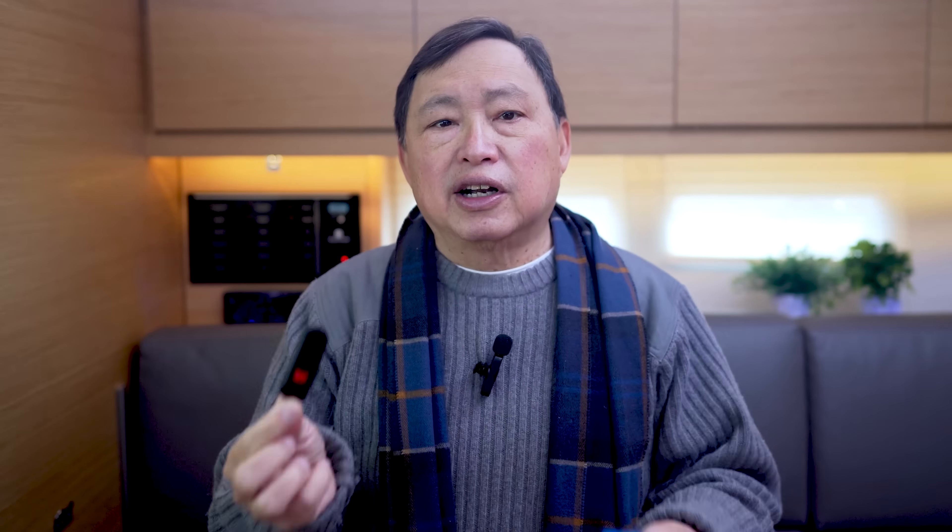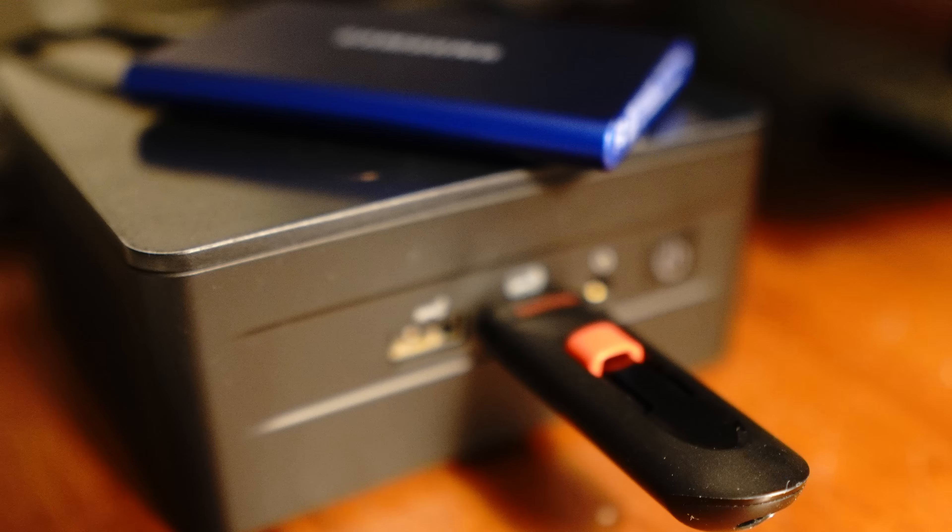Making a Clonezilla Live USB stick is a one-time process and you have a permanent tool available that you can use on any kind of Intel computer. Let's review our parts list: I now have the Clonezilla USB stick and a portable flash drive. I recommend you create a folder on the flash drive in advance where you keep your Clonezilla images — I did that ahead of time and we will be referring to that later. Assuming you've set up the computer BIOS with Secure Boot disabled and the boot order has the USB stick first, plug in the USB stick and flash drive into the PC and boot the computer. This will start the Clonezilla program.